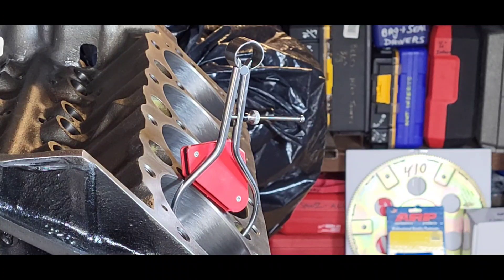If you take your block in right at the very beginning of stripping it down for magnaflux and sonic testing, it will save you a ton of time and money, because you will know right out of the gate that your block is not cracked and has adequate thickness in the crucial areas of the cylinder walls, therefore making it a viable choice for your build.